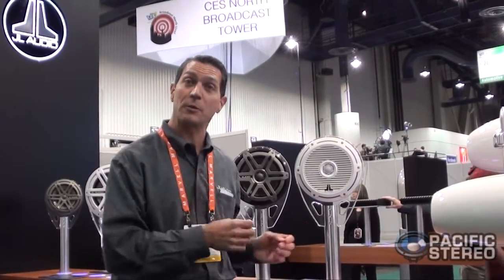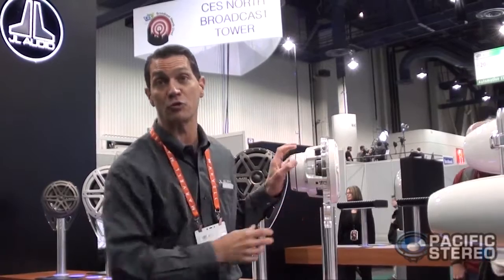We introduced the 8.8-inch diameter speaker. It seems a little odd to simply go to 8.8, but there's a really good reason. A single 8.8-inch coaxial speaker has the same piston area as two 6.5s, and what's really special about this is it's got incredible excursion capability — it can move a lot further than most normal coaxial speakers. When you combine the large piston area and incredible excursion, you're looking at about a 6 dB output advantage versus our 7.7-inch speaker. So it's not just a random choice in size — it's an actual capital item that makes a big difference in performance.